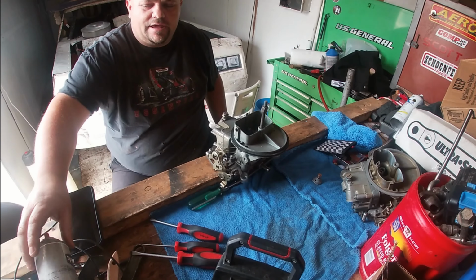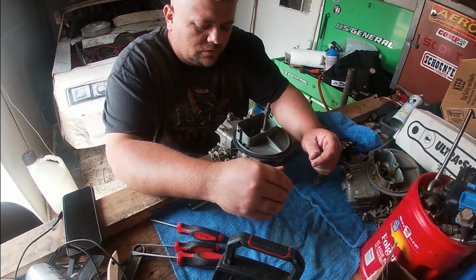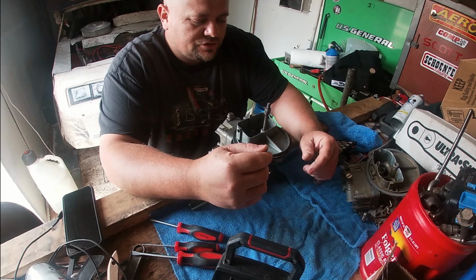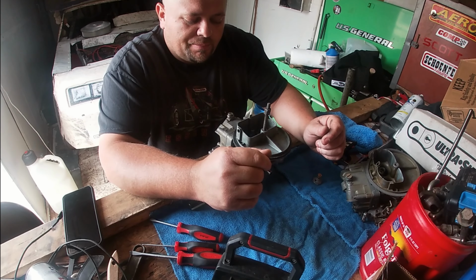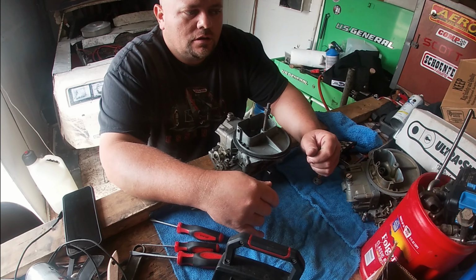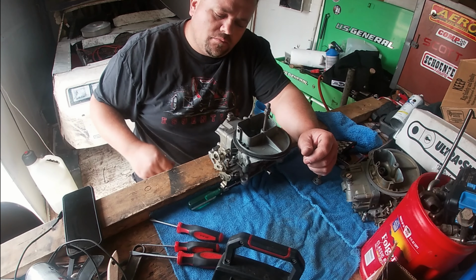So what we're gonna do today is, the last couple races I've been having problems with my carburetor a little bit. I think it's a float level. I've pulled off the bowl in between the heat and the main events, cleaned it out. We tried to blow it out a little bit, make sure there's no trash in it. It seemed to work better for the main event a little bit this last time. But if I turned too hard and drove on the bottom and turned too sharp to cut off the corners, I seem to find that my carburetor would bog out a little bit.